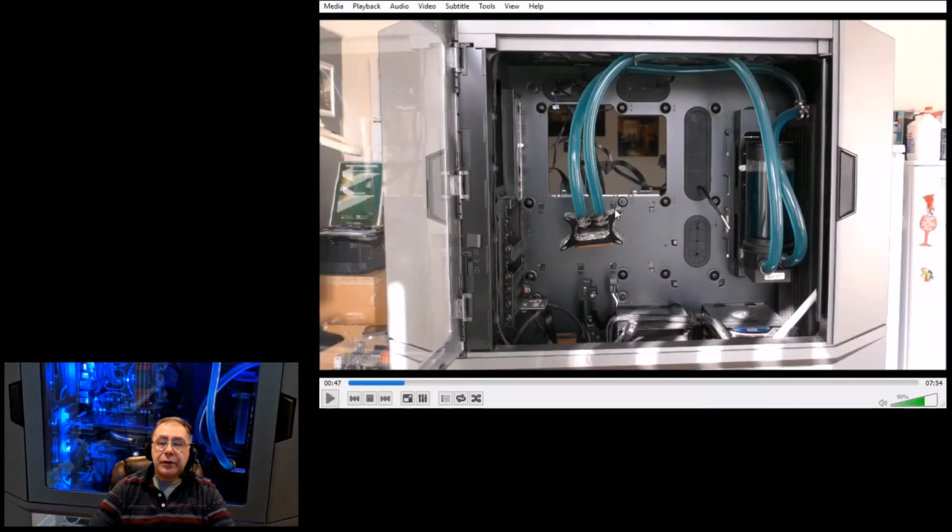Nothing too much. Right, so now I've removed the old motherboard. Now the new motherboard is actually what I call an ATX. It's a full size motherboard, whereas the other one wasn't. So if you look here, the old motherboard was covering them two holes there, going down here. So it used 6 screws, but in this case you can only put 5 screws in, because this one here is a blank. It's just a little hole which will hold the motherboard, so you know you've got it in the right place.